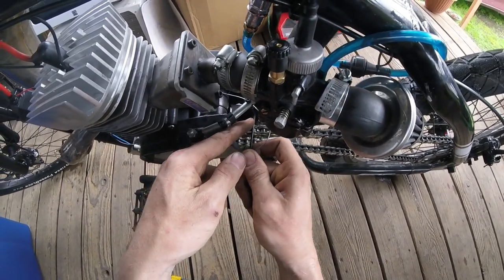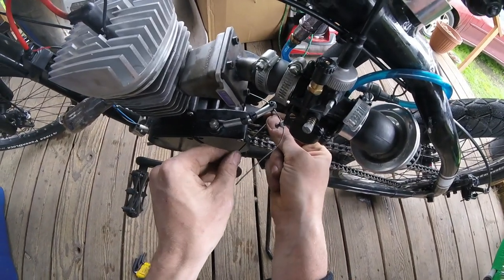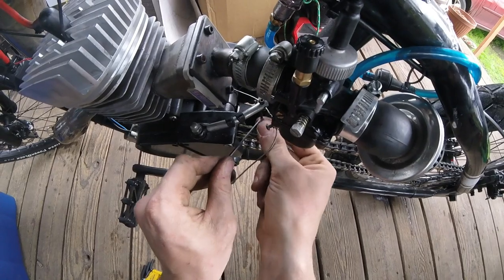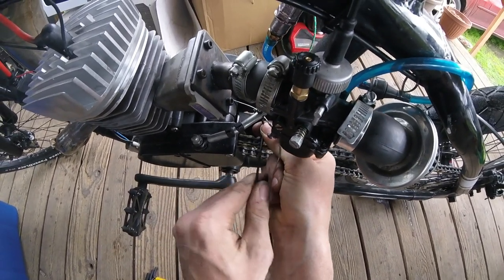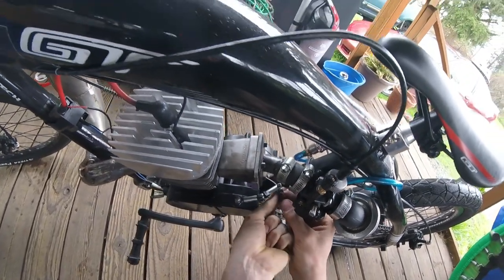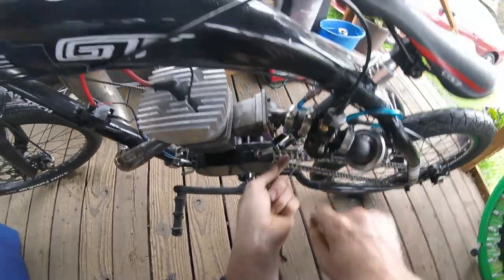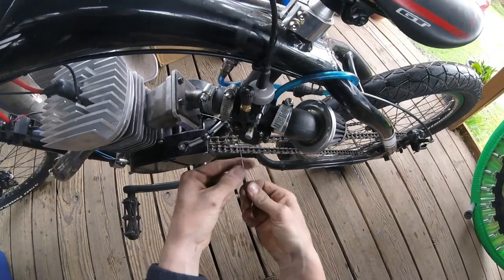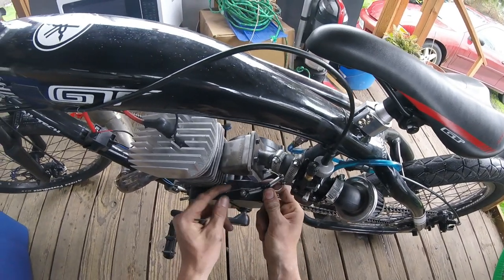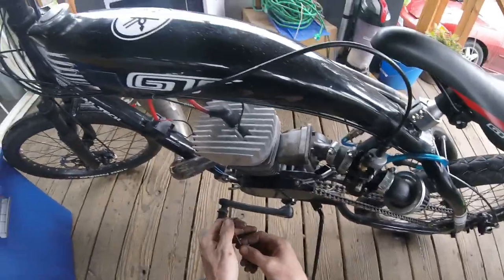Just tighten this up - make sure it's getting tight and put the tension on them. Remember, our clutch itself is already dealt with, it's good to go. I like the allen key because it makes the tight area easy to get into - a straight blade screwdriver is a pain to get in there. I'll sync up this one and tighten it by hand. Take your cable end, try to get the fray out, and if you have to, cut yourself some new zip ties. I like to run a zip tie here and here to keep the cable out of the way - when you get bit by this cable on your ankle, it ain't gonna feel good.